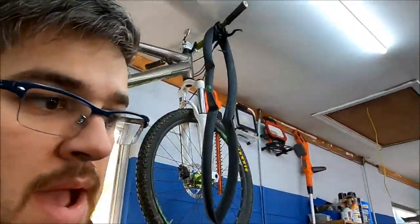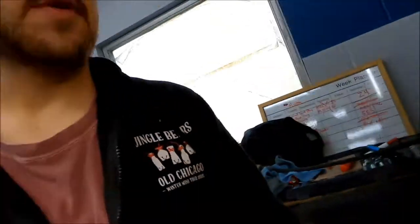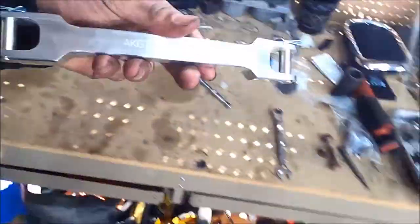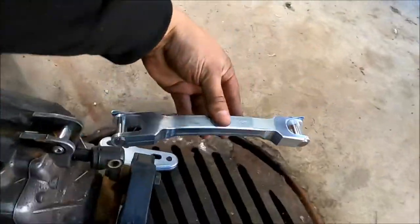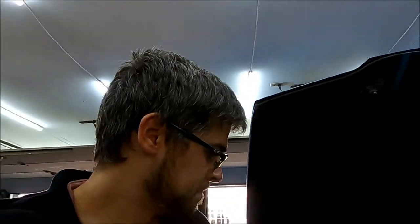Before putting the motor in, I'm going to install my dual-shear selector rod on the back of the transmission. Instead of using the OEM carrier, I originally bought an RTD shifter but after over a month it still hadn't shipped, so I cancelled and bought an AKG Motorsports shifter and selector rod instead. Here's the selector rod — it's a billet, super nice piece, and the shifter base is all billet too. I'll put it on the back of the trans now and just let it hang while I snake the motor in, then hook up the shifter once it's in the car.